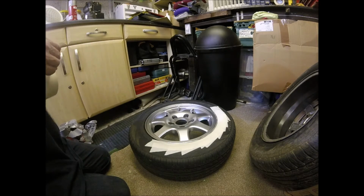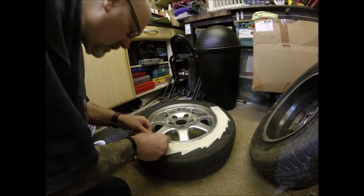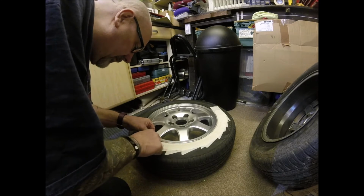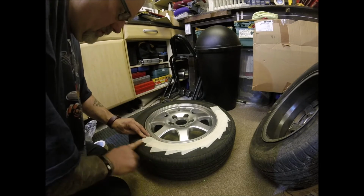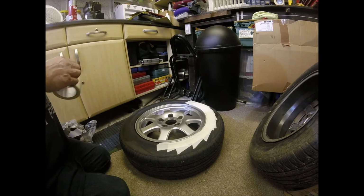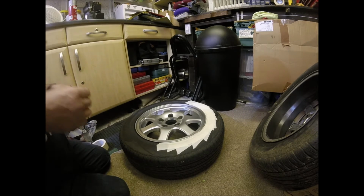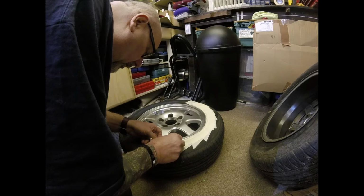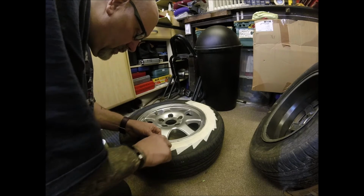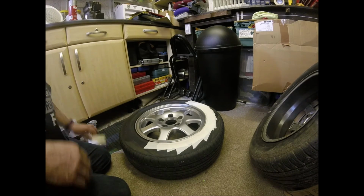The other good thing about doing this with the way that I'm doing it is it gives you that extra little bit of time looking at your tyres, because you generally have a quick look, yeah they look fine, don't worry about it. But you need to be looking for damage in the tyre. You might have run over something, you might not even feel it, because the Caravan invariably will have a different wheelbase to the car, and the car tyres might have missed it. The Caravan might have hit it. It might have been something that you flicked up with the car.